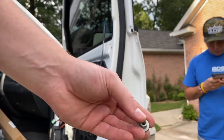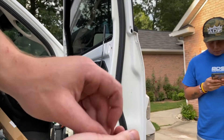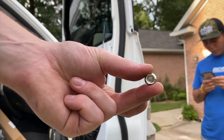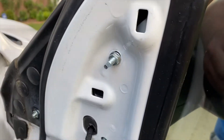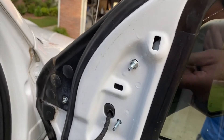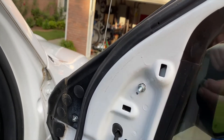The hardware they give you is actually kind of crappy. You've got the stock one that's got a big washer on the back and the eBay one has basically no room, so it looks like it's going to get pulled through putting it on. I'm actually going to put the stock hardware back on there because it's got that extra washer, and these tow mirrors are actually pretty heavy.